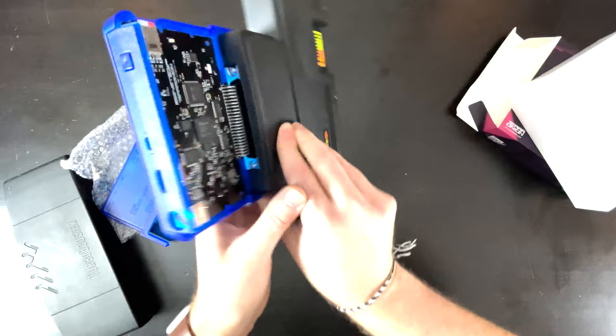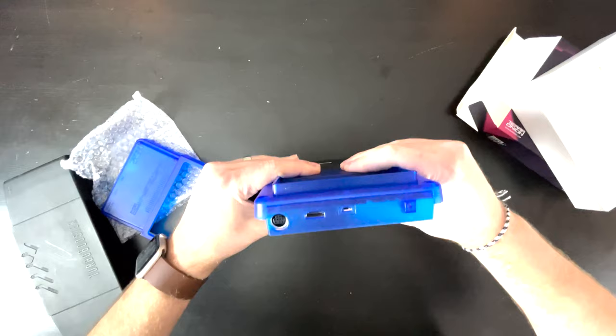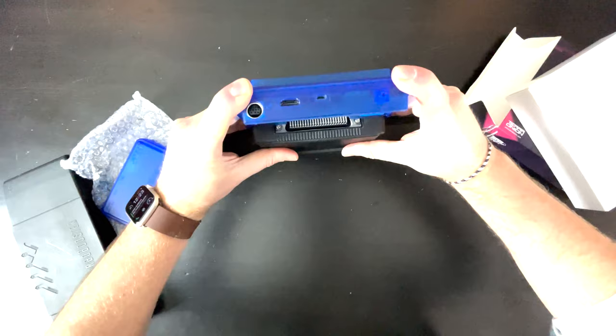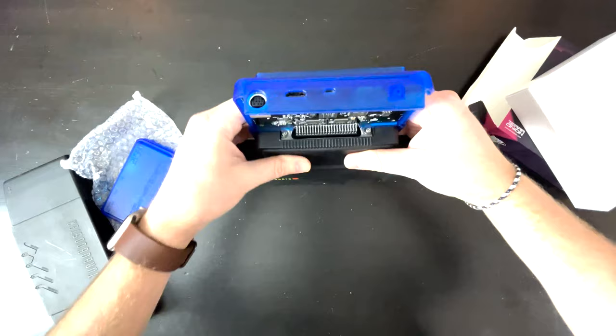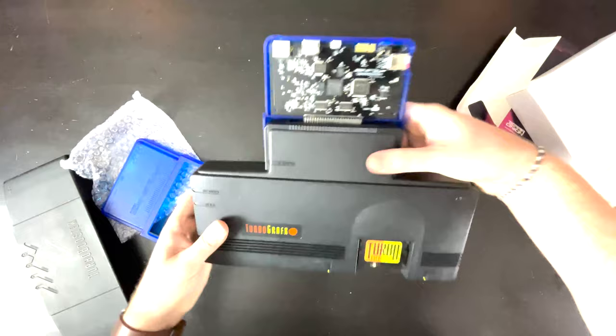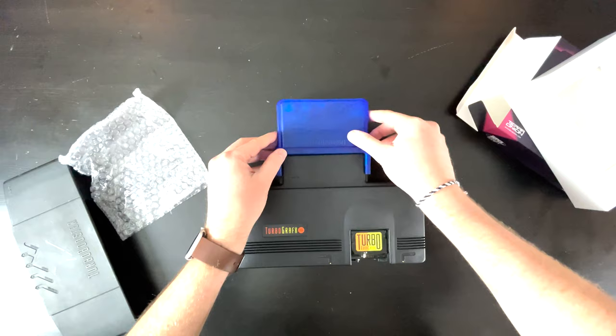So let's see. Okay, you want to make sure you're pushing up and then firmly push down on your console to make sure that it's all the way in. And it's a tight fit, like I said. Just trying to look at the light here to make sure the pins, yeah, so I've lined it up okay. Just push on the bottom here to lift up this portion. You'll see when it's lined up. And then slowly press down with even force to get them in there equally. Okay, and as I said, now that this is on, it's not ever coming off again. You don't want to be pulling this thing off and on, so make sure that when you put it on, you're ready to put it on for good.